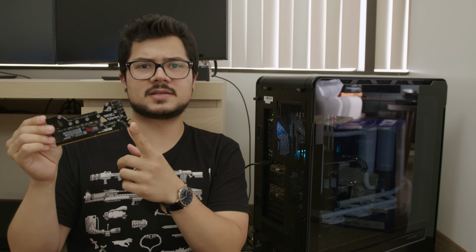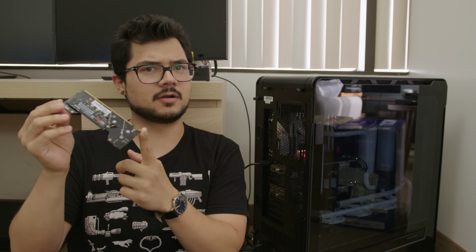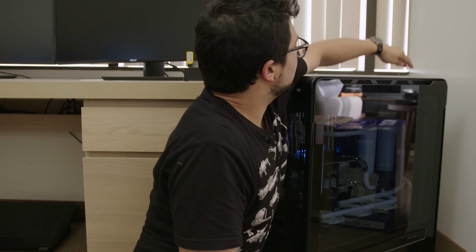So I'm gonna remove that card. I'm just gonna remove both of those SSDs, leaving only our OS disk and see if that changes anything. All right, I've got the DIMM.2 right here. Two of the SSDs. Boot it up. Let's see what happens. Still says A2.